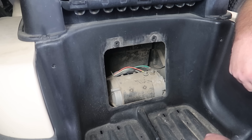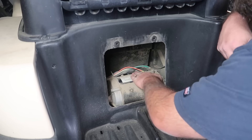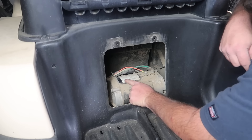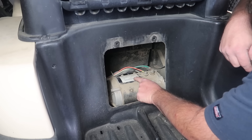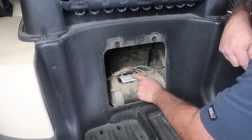Once you have the cover off, you can wipe off the motor to get the numbers so you can send them in to Plum Quick. Ours is right here — it tells us this is a Club Car, this is a 48V DC motor, this is a 3.3 horsepower motor. It's got the Club Car part number, model number, and rating.